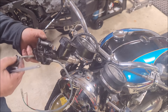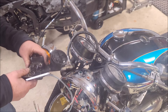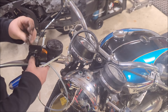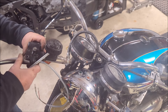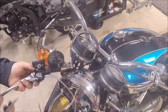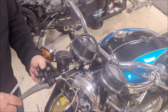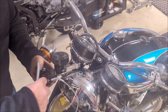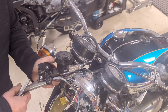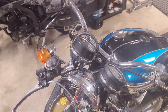So now what we want to do is put our brake lever back in. We first have to align our little push rod for the hydraulics, and then put our pin bolt in and give her a go. You can kind of see how this is going to work — on, off, on, off — and you can see the pin in there actuating as we do this. As we put the brakes on, the brakes are going to work. At least that's the theory. Let's hook up a test lead and just make sure before we completely button this thing up.